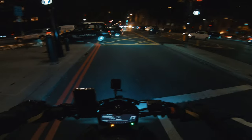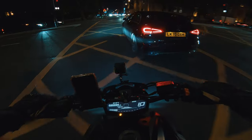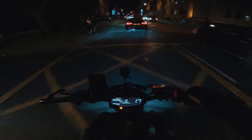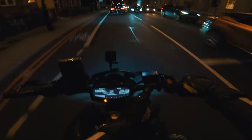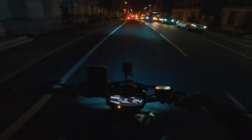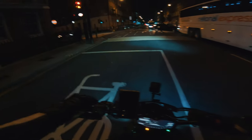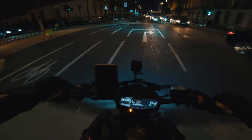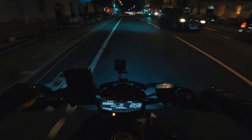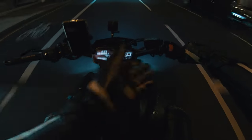And they are perfect. They're so much easier to ride with, they're easier to filter with. And I actually didn't have any problems installing them or fitting them. Normally on a motocross bar, you have these two little clamps on the side that hold the little foam bar in the middle. And on the ProTaper one, I legit had to hammer that thing off. But these ones, I just unscrewed it, cracked it off the glue, because it's usually glued on, and just slid it off the bar. Easy as. Then I cleaned the residue off with a little knife and some rubbing alcohol, and the bar literally looks like it never had those clamps on it, and it's all blacked out. And yeah, I'm really happy with it.